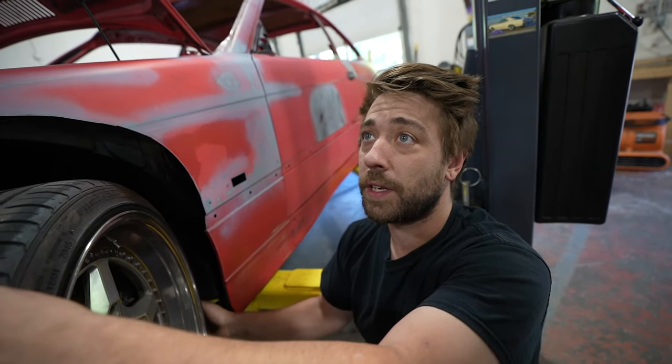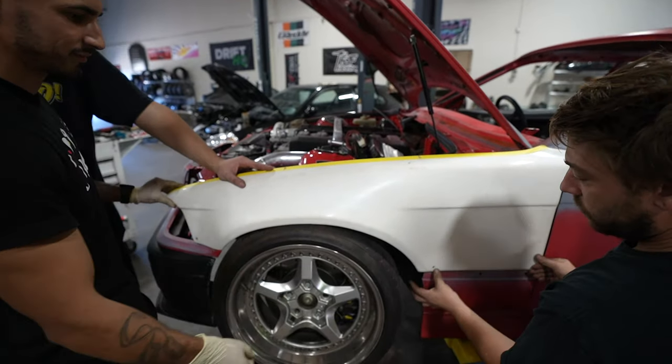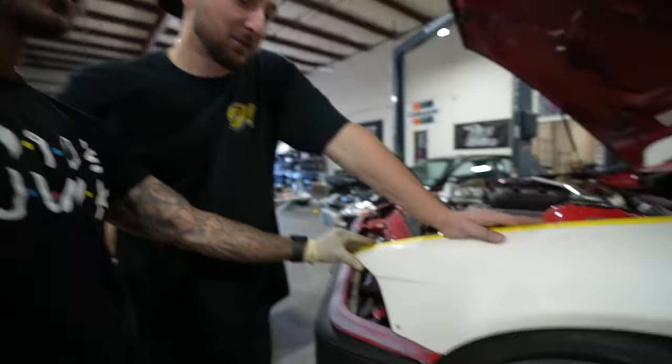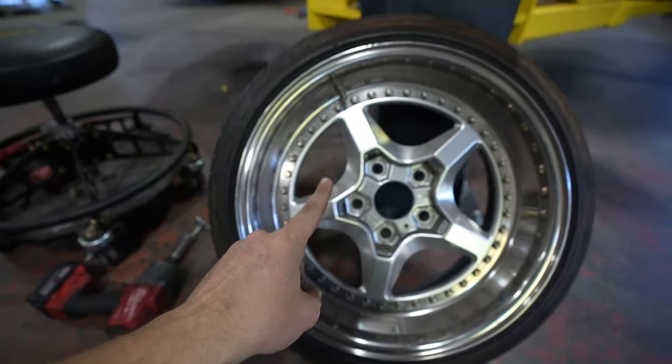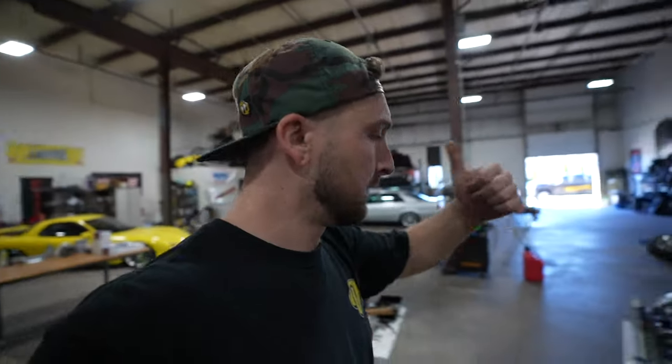This is their third iteration of the kit or maybe even more — ten plus years of development. We don't have to go too high with this setup, which is really nice. Two turns on the coil — we're done. I completely lied to you guys, I'm sorry. These are actually 17 by 8.5 plus 11. If I get 8s with a little bit higher offset it'll fit better. But I think we're going to cut this arch out because a lot of guys with this kit end up doing so just so we don't have any clearance issues in the future. SLR — cross off the list.